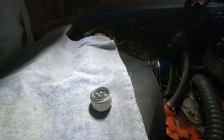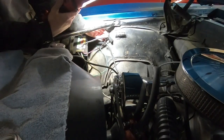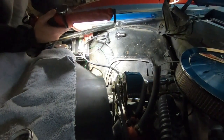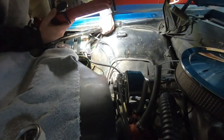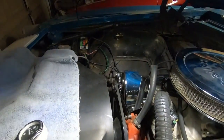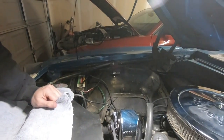The other thing we wanted to show you, this guy right here. You can go buy your own amp kit and spend quite a bit of cash, or you could probably buy, what gauge wire are we running? We ran 8-gauge wire. We're a 360-watt amplifier, so 8 gauge is more than enough. The 0-gauge that was in here before was just a joke, overkill. It's just too much. We want tunes, but chances are we're probably going to be cruising and not have any tunes on anyway. The car should be really close to rolling.